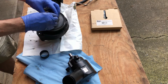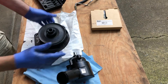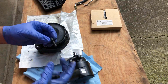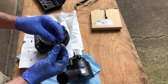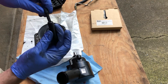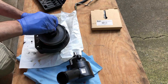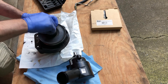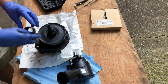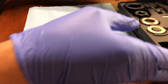I realized when I was editing this that you couldn't really see what I was doing with the pulley kit. So let's look at the pieces you're going to use. You've got this piece with a hex on one end and a threaded hole on the other. There's also a flat piece used when pulling the pulley — it has a flat surface on one end, and the other end has an O-ring that just slides in without threading. Be sure to put some grease on that O-ring so it doesn't get damaged. The threads also need some grease.